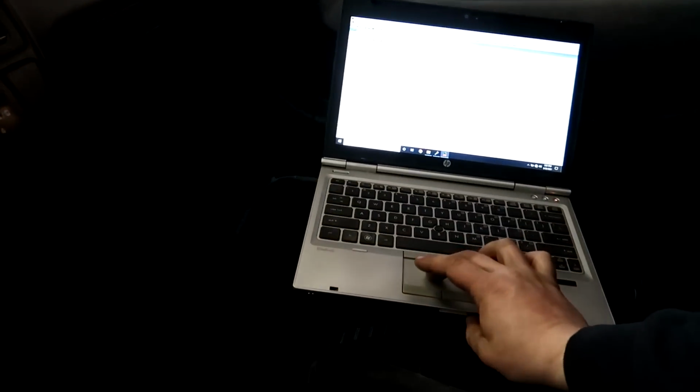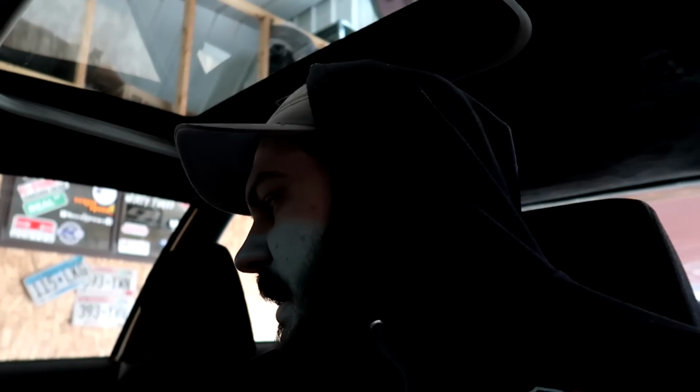Alright, so we've actually been working on this car for quite a while now, just tinkering, trying to figure out why it's down on horsepower, and I think one of two things is going on. I figured it would be a cam timing issue or ignition timing issue, because it just didn't seem like it was happy, and the power curve was doing a little wave. It kind of comes in and out of power. So I'm like, okay, something's going on.